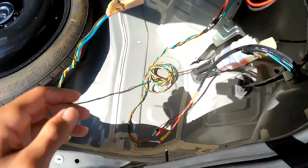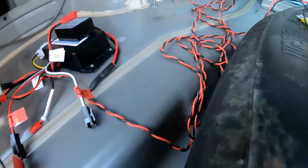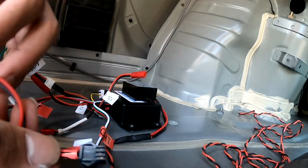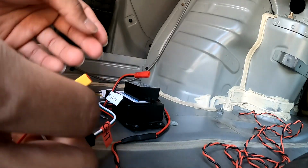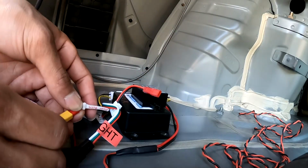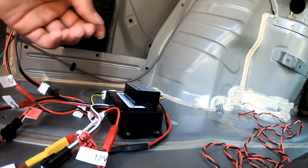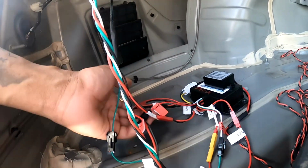They're done here. And then you gotta take this final end and connect it to the controller. So again, you have one that's labeled as right. Find the one on the controller. Make that connection. Right turn to right turn. And then 12-volt supply. And then that's everything. So now all the wires are connected.